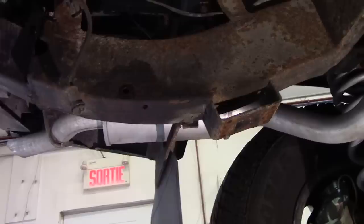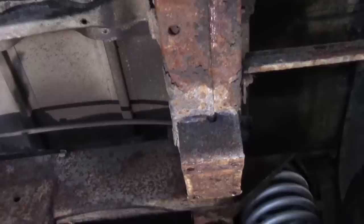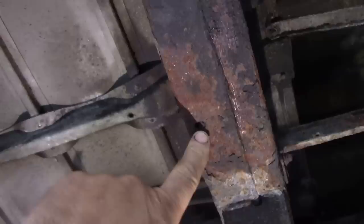Once those bolts are in and the hole's blocked up, these low spots can fill with water and it can't get away. What I do with my chassis is drill a big one-inch hole right down here on both sides. Just a little word about these chassis: when they came from the factory they were dip-painted, meaning there was paint inside the chassis as well. Chassis generally rust from the inside out because of condensation, and we can already see flaking rust here, which isn't looking good.